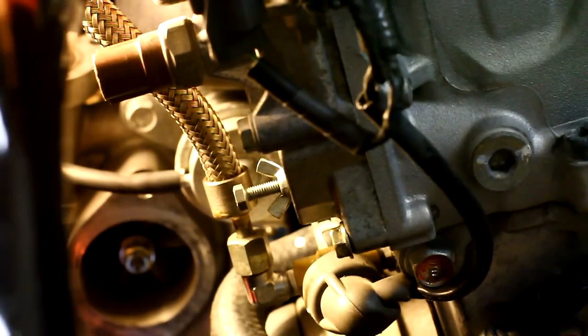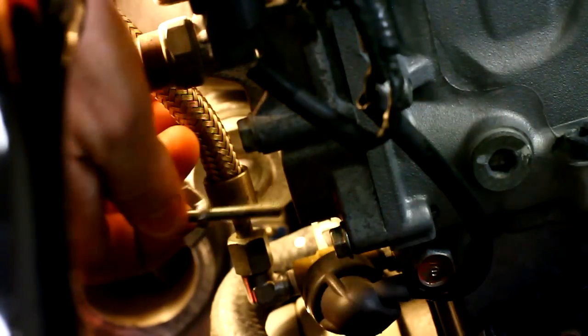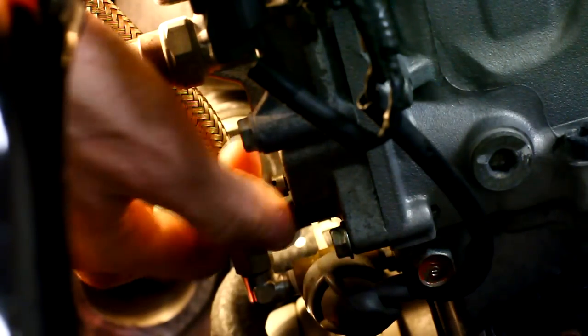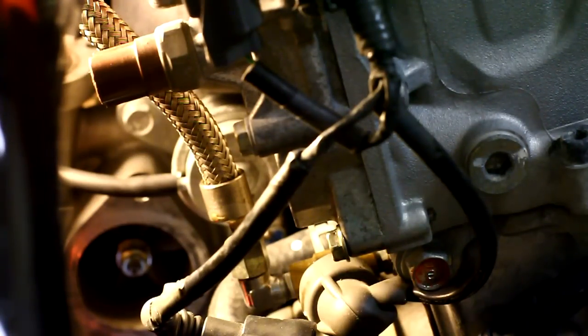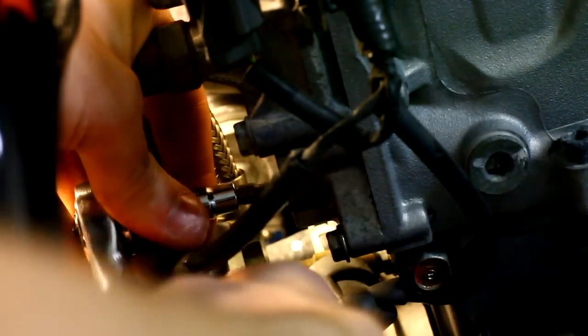Very easy after this. Remember our wing nut and the small bolt we installed earlier? It's time for that to come out. It's pressed up against the chain on the inside of the car so this has no relevance anymore. Just loosen your wing nut and then turn the big bolt — it should only take a couple turns — and slide it straight out. Once you've got that out, your plug goes in and screws in like normal. It does not have to be that tight, just a snug fit.